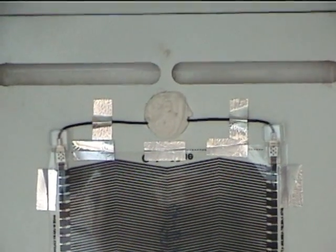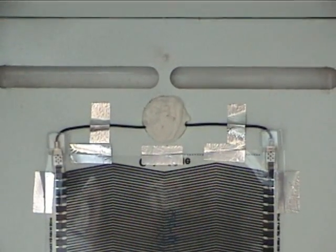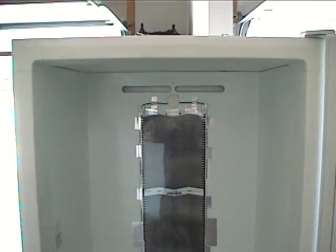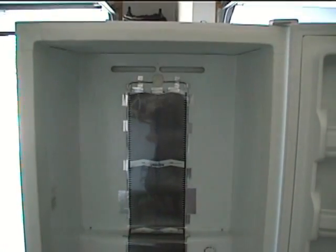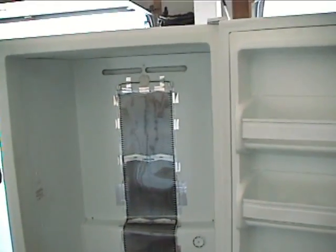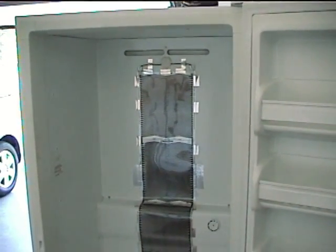Filled it with foam and it works really good. I'm going to put the cover back on the vent holes at the top. Then all I have to do is drill a hole in the top of the refrigerator in the center and mount the thermostat, drop the probe down to about the middle of the freezer, install the shelves back, and we'll be good to go. So it's really a simple process: take out the guts from the bottom, leave the fan in if it has one, wash it up, put your heat tape and thermostat in — basically it's an insulated box that works perfect for an incubator. Hopefully this video tutorial helped you out.